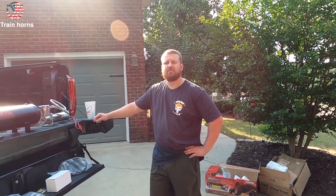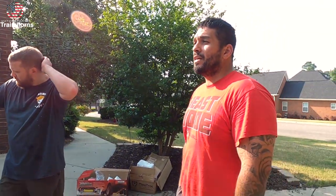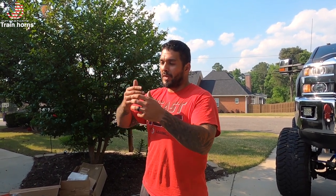A lot of companies sell train horns, but I don't really like ones where the pitch is too high. An off sound is usually an indicator of two things: water in the horn, because your train horn is just a diaphragm inside the bell with gaskets on either side — air passes through, flexes the diaphragm back and forth, and that rapid movement creates the sound. The second cause of high pitch is too much pressure.